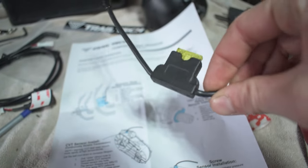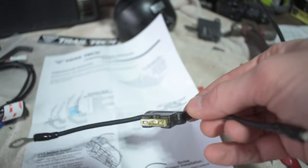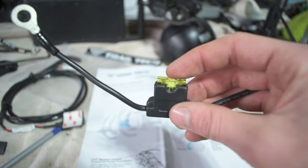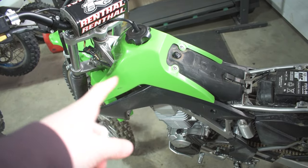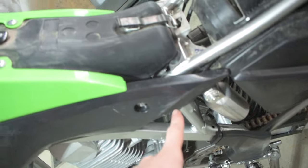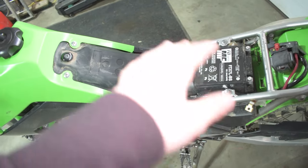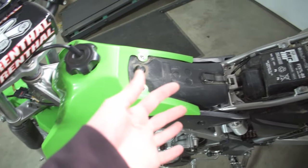Now we're going to jump to the next step and install our power wire that actually powers the unit when the bike's running. It's recommended that you use one of these fusible links — in case you were to short out the wire, this fuse would pop before you have any sort of fire issue. So we're going to go ahead and remove these plastics so we can properly run the line down where the frame has all the rest of its power wires going, so everything's nice and neat and tidy and we don't end up pinching off the line and causing a short.